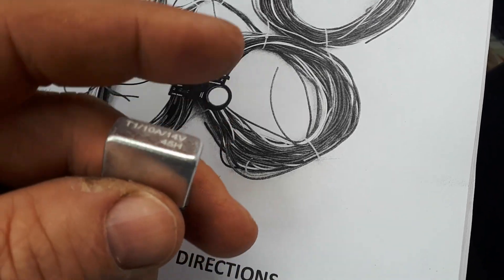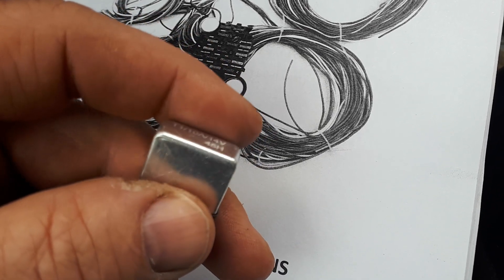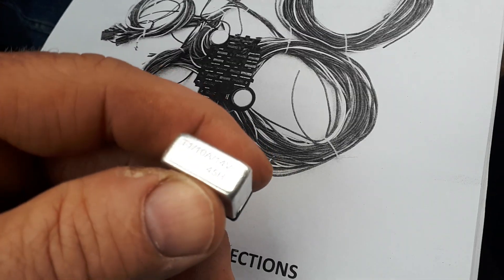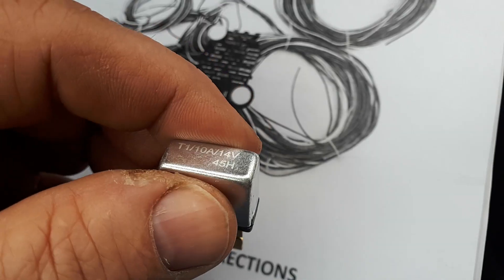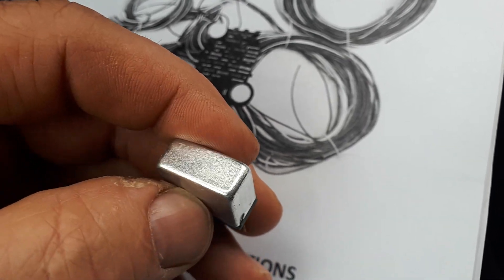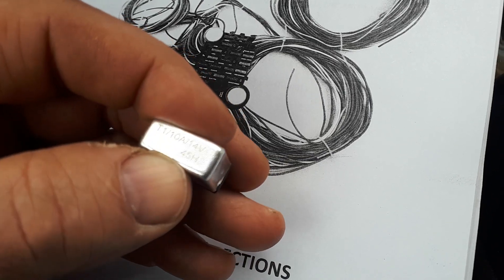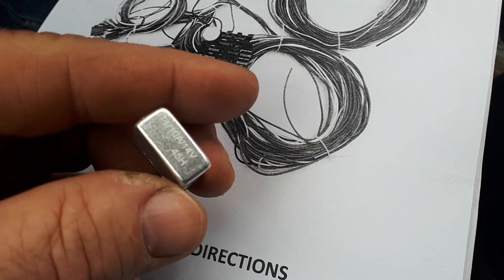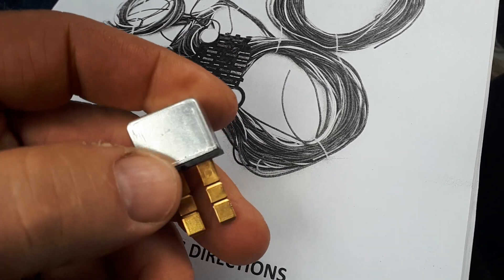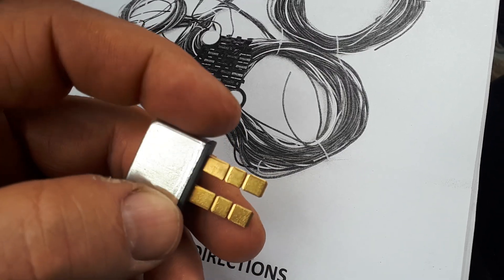We had a circuit like that on an old Chevy truck — it would blow a fuse once in a while, once every week or so. We never did find the reason, but we put one of these in and it would trip. It turns it into a breaker that resets itself. It would go off, and then within five or ten minutes you'd put your fingers on it and it would be hot as hell — you'd almost burn your fingers.